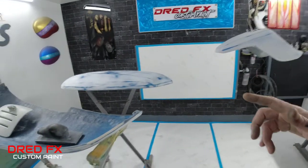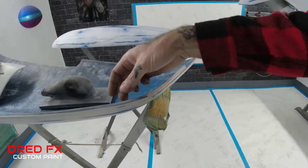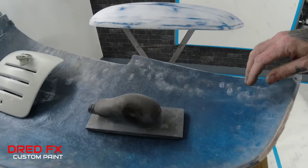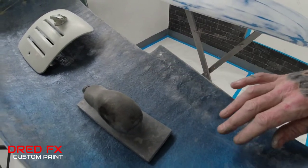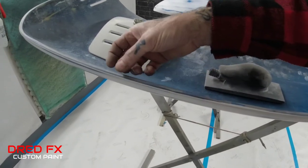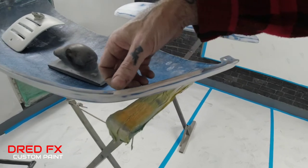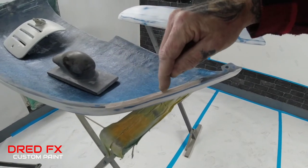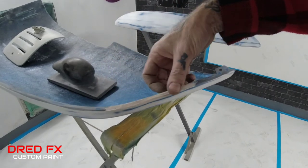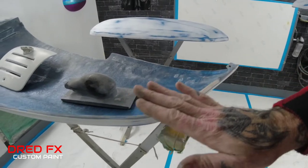Now we've got a little bit of filler work to do here. When I was knocking this back where this edge is on the fiberglass — because you can see the finish on this bit — they're not brilliant on these edges. There's thin bits, thick bits as they go around. So when you came around to this bit, it was sort of like a little crack in there and very thin. So I've just built that up, put a skimmer filler over, built it up and we're just going to knock that back flat.